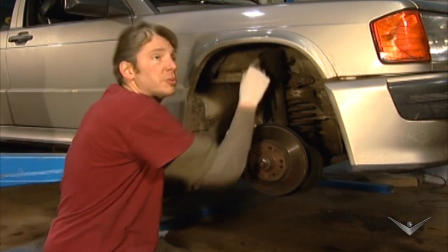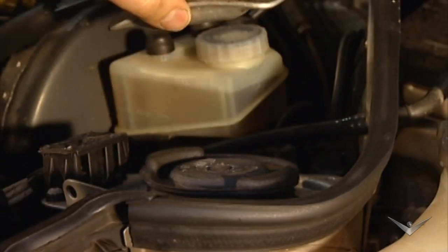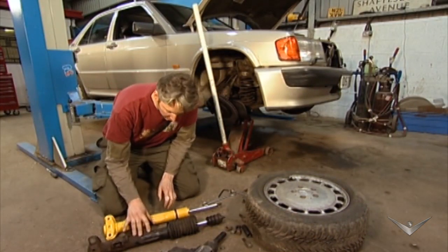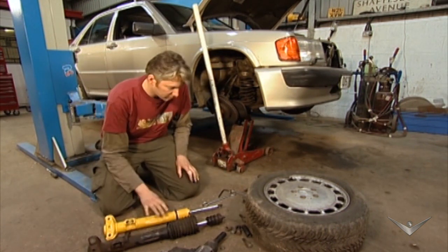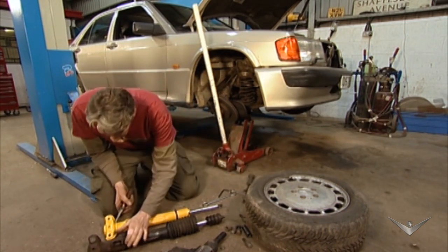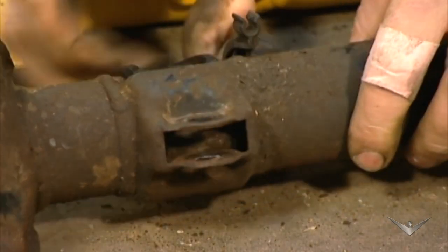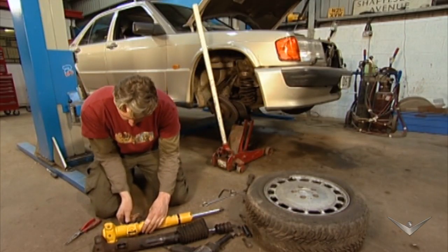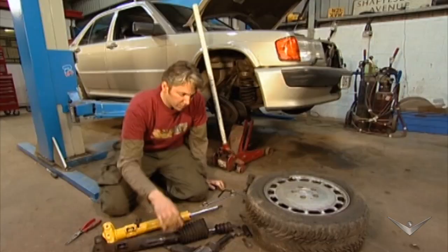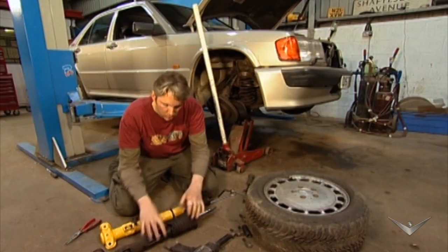Now of course at some point I'm going to have to take the top off, which means I have to open the bonnet as well. That's quite clearly the old one there and of course this is our lovely new yellow one, but I'm going to have to replace a couple of bits from this side to that side. First of all there's this little plastic clip here that holds on some cables that go towards the caliper — just work it out and it pops back in place. Then there's this bump stop and the gaiter.